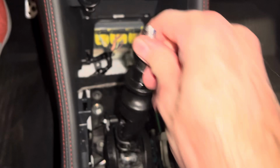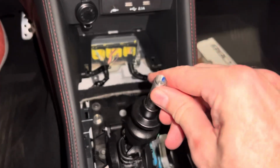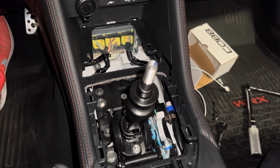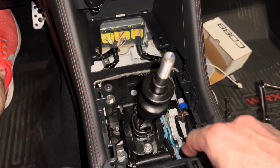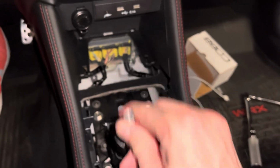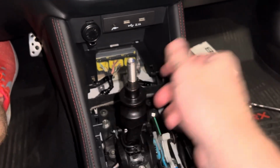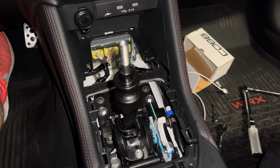So I'm going to run through the gears a bit more, and then probably throw the Loctite on there and button it up in the reverse order, but anybody can figure that out. Put the cover back on, put the knob back on, that's easy stuff. So again, I'll tighten them up, torque again to 5 foot-pounds, 60 inch-pounds, Loctite, done. We'll see how it fares. I think it's pretty good. It's a pretty good reduction. I'll report back after driving it. Hopefully I don't have any problems getting into gears because I got to work tomorrow.